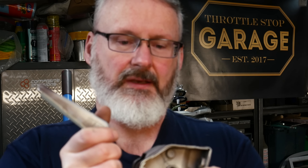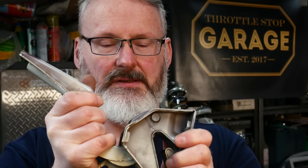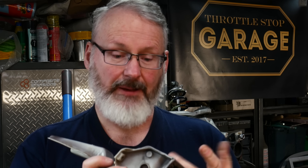As with a lot of these sorts of hinges, the pivot points just wear out over time. We're working with a car that's sort of 60-plus years old. These were never supposed to rotate on the pin — they were supposed to rotate around a bushing and the pin was meant to be fixed. What's happened is paint and rust over time have seized that joint, making it so that you're rotating on the part that was never intended to be rotated, and it didn't last very long as you can tell.